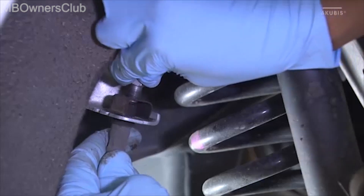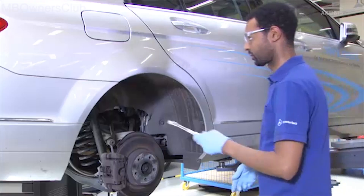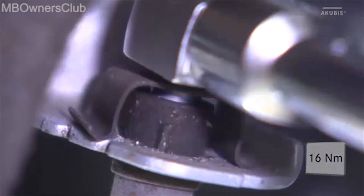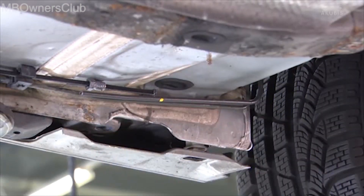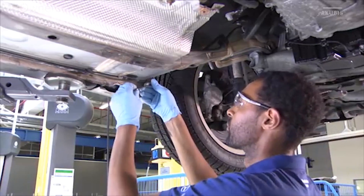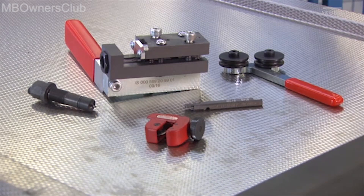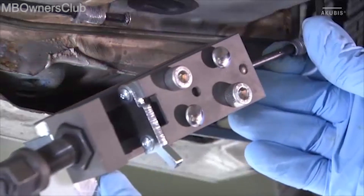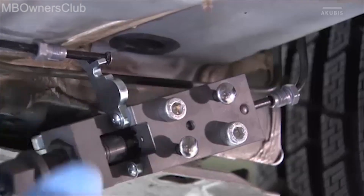Connect the new brake line to the connection point to the brake hose. Use a torque wrench to tighten the screw cap with 16 Nm. Shorten the line left on the vehicle to the correct length, then tighten the screw cap with 16 Nm. Now flange the line onto the vehicle with the special tool. Tighten the screws of the special tool using a torque wrench, using the torque values specified by the manufacturer.